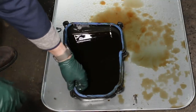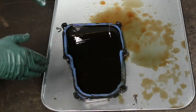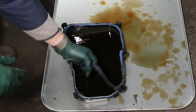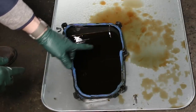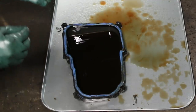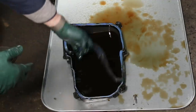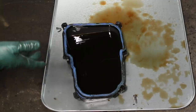You put these seals on dry, totally dry. You do not use any RTV. RTV is the absolute worst because once the oil gets in there, it just wicks right by the RTV, particularly if you don't get a perfect seal. RTV is only good if the two mating surfaces are absolutely, microscopically clean of any oil products. I see mechanics slapping RTV and silicone sealant on everything, and if the surfaces aren't perfectly clean, this is what's going to happen — a pan gasket that's just been leaking fluid all over the ground.